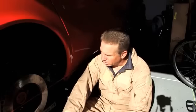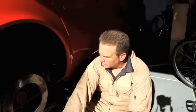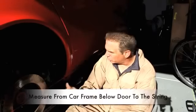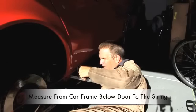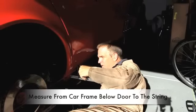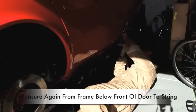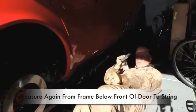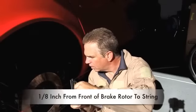not the deficiencies of the tire. I take my level, put it on the 2x4, and what I'm looking for is the bubble to be perfectly centered. When I do that, I know I have zero camber when the level is at center. Camber can be adjusted by loosening this bolt right here and turning it to the left or right to increase or decrease camber. There is one on each side for each wheel.